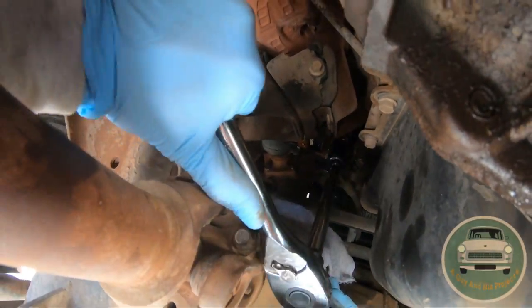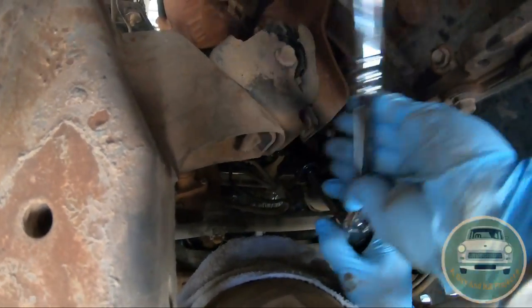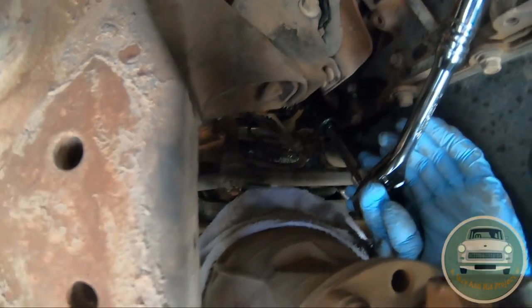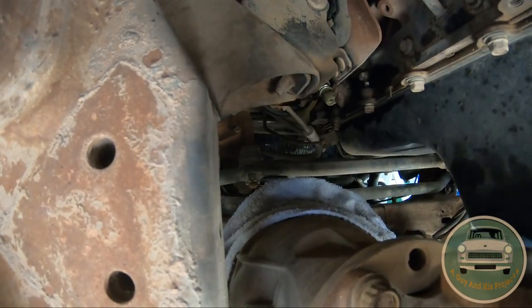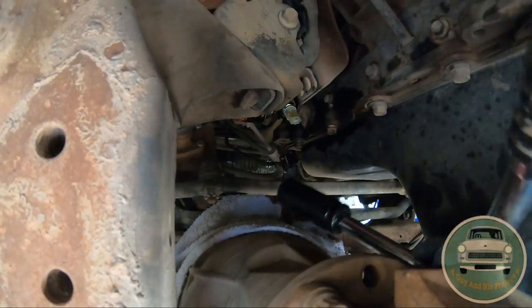From there the project is not much more difficult. We are using a half-inch ratchet with a 12-inch extension and a 21mm deep socket. You just stick it over the harness — it fits just fine — and start working it loose. We did switch to a 6-inch extension; we just found we had a little more room up closer to the unit itself. Work it loose until you can spin it with your hands. When you get it out it will spill some oil — not a lot. Plug in the new one as quick as you can to minimize the mess.